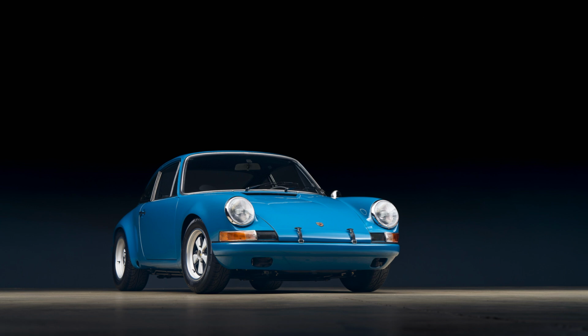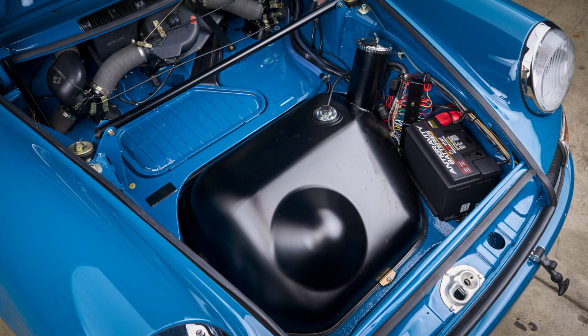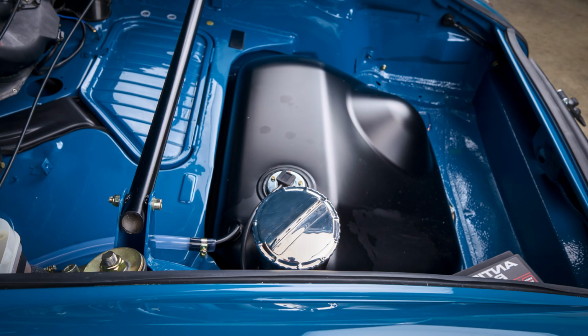As we're just looking in the trunk, we'll start there, and then we'll go to the suspension. So obviously, a 100-liter Dansk brand new gas tank with the 100-liter fuel sender, which was calibrated with all the gauges when they went to the Palo Alto speedometer. I had them calibrate that and test it to make sure they work, because they don't all work out of the box. So we did that. We clearly have modified the tank. My uncle's original ST, this is how you filled it. It was a factory ST, and you opened the hood to put the gas in.